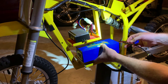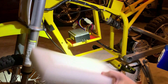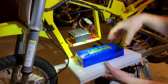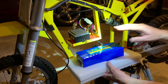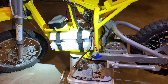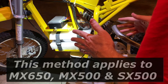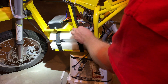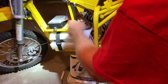To fit this battery in the frame area, the old supports don't work, so I'm going to use the foam the battery was shipped in, cut it down with a bread knife, set it right in there, and build a cradle around it. I've now packaged the lithium-ion battery into the MX 650 — same process works for the MX 500 and SX 500. I used velcro straps, which you can buy online — linked in the description — and slid them underneath the battery tray.